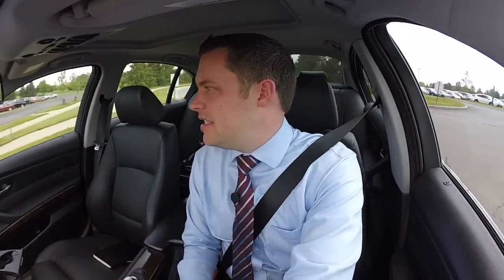Even with a CEL — I've had a few major check engine lights in the past, erased them to see if they'd come back, and they never did, and that was three years ago. You never want to replace BMW parts for a check engine or service engine light without confirming it's a real issue — it could just be a small tick the DME saw and triggered. My rule of thumb: erase it a few times to see if it comes back. That's your sure answer. Use proper scan tools, erase, read again — if it keeps coming on, then take the next steps to fix your problem.